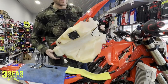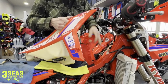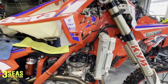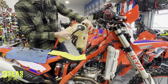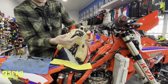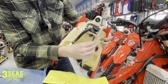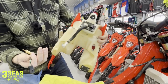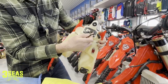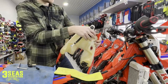If I flip my gas tank over — to take my gas tank off, we had the dual ignition map that we unplugged here, the two lower shroud bolts on either side of the bike, the actual fuel hose in the back, and then the power connector for the fuel pump. So there are three electrical plugs: the dual ignition map, low fuel, and fuel pump. Easy to take the gas tank off — only a couple of connectors, takes like a minute.